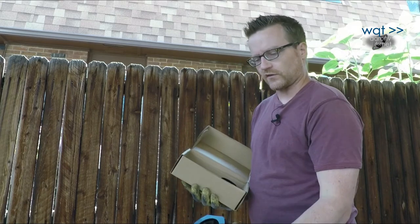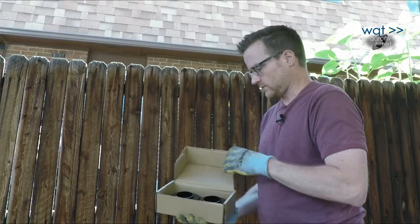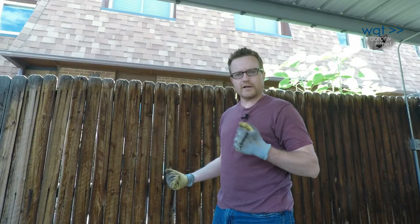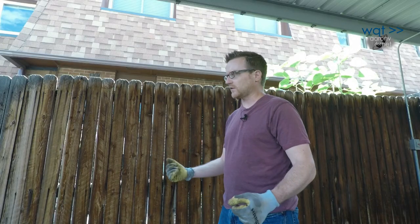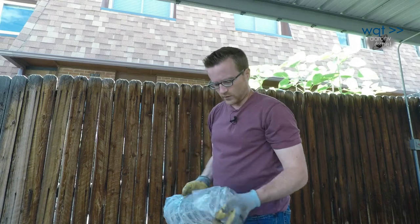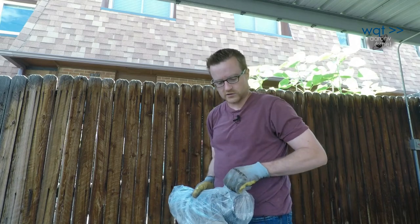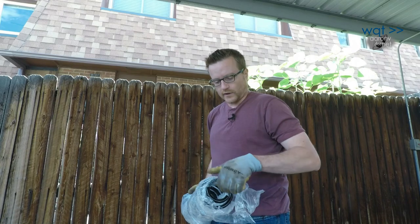These are polyurethane, you just install them above on the spring perch above the spring, and then it just adds that distance. But after looking at the situation a little more, I realized it's not that difficult or expensive to just put in the coil springs that belong in the front. So this is a heavy-duty coil spring that's matched to the rear leaf springs, and so it should give roughly about the same 2-inch lift as well as helping with towing capacity.